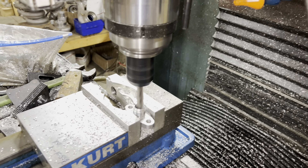The holes on the thrust bearing are different — his is a little more outer, mine is more inner. My hole matches this one, and because of that this S300 bearing won't work. To make it work I'd have to drill a hole, but I'll just use his since he already bought this rebuild kit. This wheel rubbed and put some edges here, so I'm going to file all those down — you can see where I filed that one down.